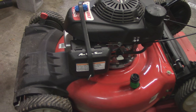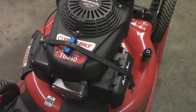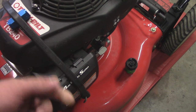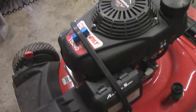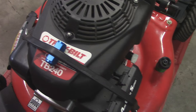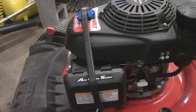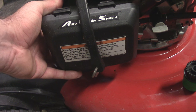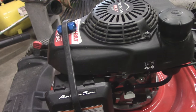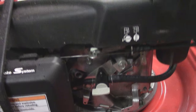Well, this push mower is finally done — at least I think so. I've had this thing for quite a while now. For the past year I've had a bungee cord on the carburetor, and over time it's lost tension, so I had to put a little fitting on there to give it some more tension. This thing will not stay running unless you lift up on the carburetor. I have no idea why. I've had several people look at it — none of the linkages in there are bent or anything.